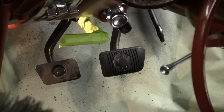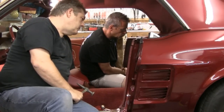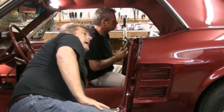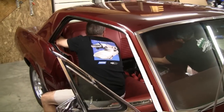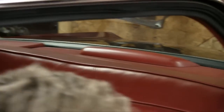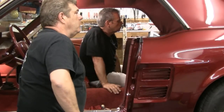We can just take a little bit of oil, something like armor oil, and try to make that a little slick. We're going to put the seat back in in just a second, but I wanted to give you a tip: if you have a fastener that has bellied out like these have on this back seat top, you can actually take a hammer and flatten the hole out, and you should be able to get the fastener to hook at that point. Larry's already done the other side. Wow, that's much better — definitely a lot better. We've got a little bit of a slope in the center, but at least it's symmetrical. And it's sitting on the break line for the seat back where it's supposed to be, and it's not even fully in position yet, so I'm pretty happy with it.